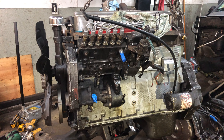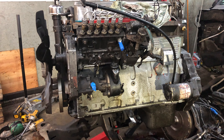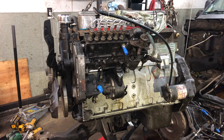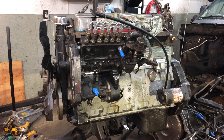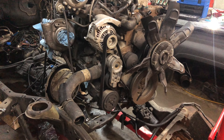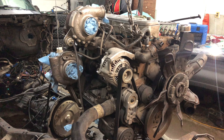Right up in here — this thing's very tattered — that's how you actually get the push rods out: you put them up this hole and then move them out. Very tight squeeze with this engine sitting in there. This thing is freshly rebuilt, and unfortunately I've got some scoring on the cylinder wall, so time will tell if I can just hone those cylinders and get them good enough, or if I'm going to have to get it bored out 20-over, which means new pistons and rings and all that.